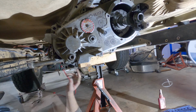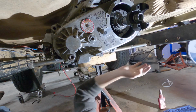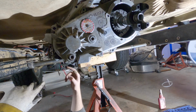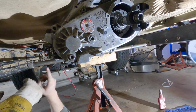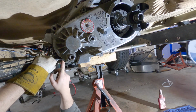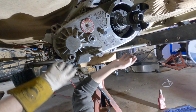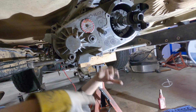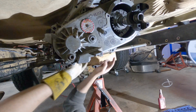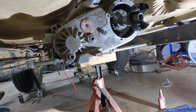really good. So now what I'm going to do is actually take this all out. I'm going to drill holes throughout everything. And then I'm going to come back underneath here, put it all back in, and start doing little plug welds. And I'm going to put a couple of welds on these 2 cuts. And once I'm sure that this bar is semi-solid, I'll unbolt it and then weld up the entire bar outside from underneath the Jeep. But I want to have a couple of weld spots just to make sure everything's aligned up. So, back to work.